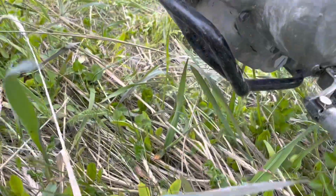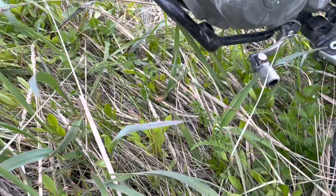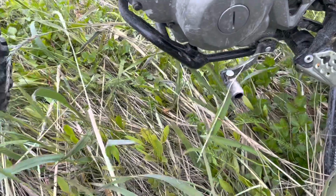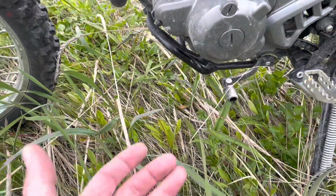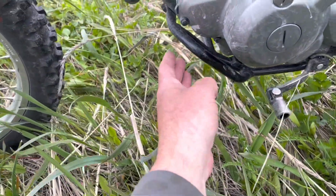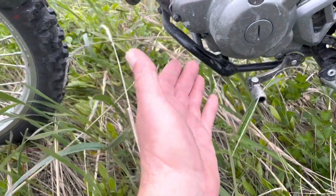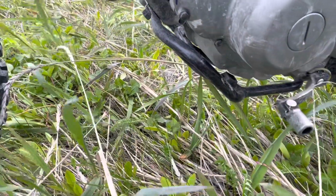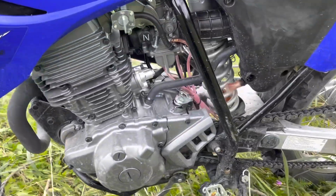You've got a tubular steel bash guard under the motor, and it actually has little rubber cushions. And I was looking at getting an aluminum skid plate, and then they actually replaced that, and I'm not really stoked on doing it. And then you get that noise coming from the aluminum skid plate. So I actually have a piece of plastic and a heat gun. I'm gonna contour it so it fits that stock metal guard, and clamp it on there, and that's what I'm gonna run. I think that's gonna work pretty well.